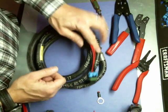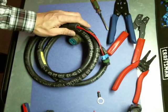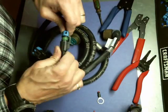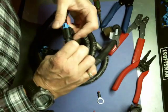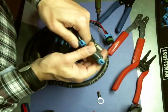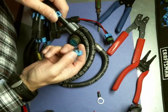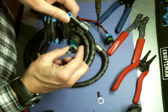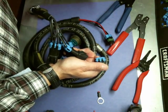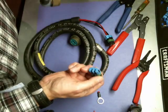Real easy process there. We can also show how that is connected to the Medusa cable — just like so. The Medusa cable has a seal on the lock and the housing. There are also some seals there that are a little bit difficult to work with; they have to be opened, removed, and then trimmed off. I recommend just getting the blue ones — a lot faster than having to cut around on those. They're only about 10 cents a piece through DLA.